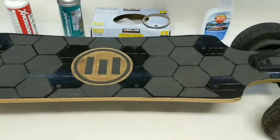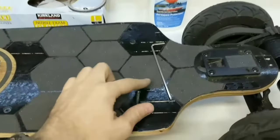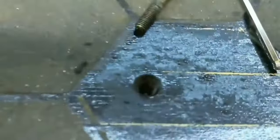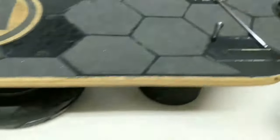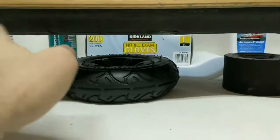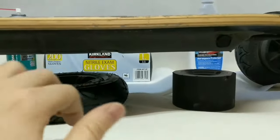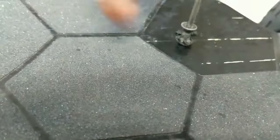Here's a detailed look at the screw — once unscrewed, you can see the rubber seal bushing mushed in there, with pieces coming out because it's been months. When doing this, make sure you put something underneath — like spare wheels or books — so the board doesn't fall all the way down when you open it. There's a lot of gunk in there, but hopefully no water got through. That's usually just the rubber seal or o-ring residue.